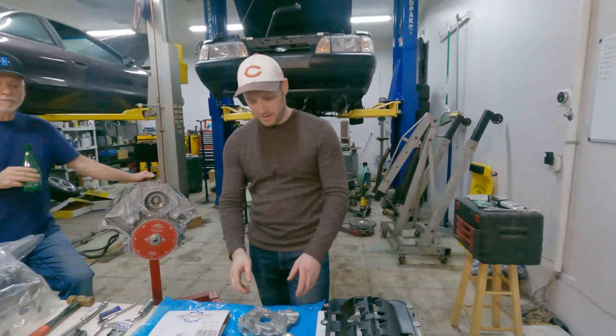All right, we're ready to turn it over. It's eight cylinders. I hear some squealing — it's because it doesn't have any oil pressure in it, so it's compressing on the loose valve spring pressure. But the motor turns over. Cool. Rock and roll. We did it. It's a long block.